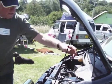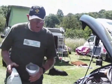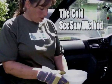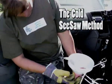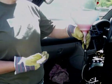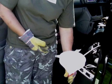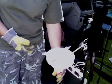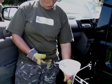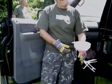We're ready to start seesawing to get as much air as we can out whilst it's cold. Without the engine running, just seesaw the bleed hose backwards and forwards, not letting the level drop out of the bottom of the funnel — just go up and down. That works the air bubbles out of the system before we get the engine going. Nice and slow — you don't want the water vortexing down because then it sucks more bubbles back in. Keep doing that for a few minutes.